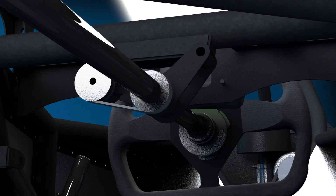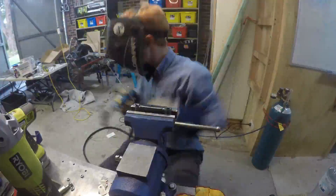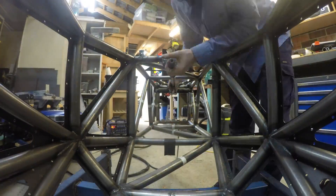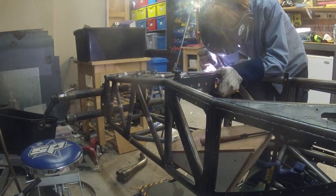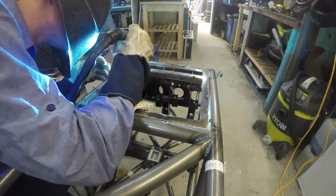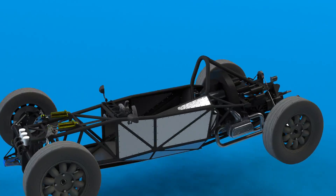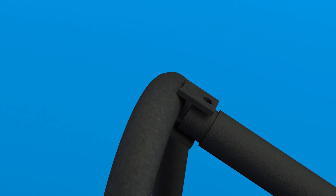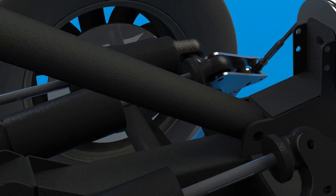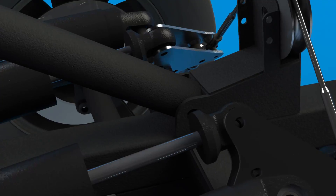There were only a few smaller mounts left. A simple boxed section with two holes for bolts to mount the bracket for the steering column. Next were the mounts for the dashboard, which also provided secondary mounts for the bodywork, and the mounting plate for the pedals and floor which will also stiffen the chassis. One of the last mounts to go on was for the rear roll hoop brace — the design was dictated by the rules, as was the brace itself where it connects to the roll hoop. I tied the other end into the transmission subframe.